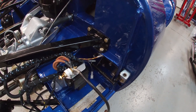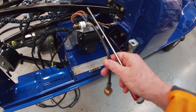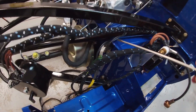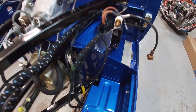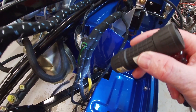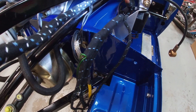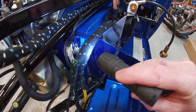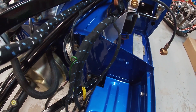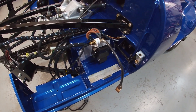I actually have that unit on order and it should be coming in the next day or so. I've also attached a positive terminal for the battery on this side of the post. Let me get my torch. I've done the connection for the earth, which includes the earthing wire for the battery — negative earth on this vehicle, as I found out to my peril earlier. I've also connected the alternator earthing wire and the main earthing wire to that joint there. It's a relatively simple harness to put in, and I'll finalize all the connections when all the pieces turn up and the engine gets installed.